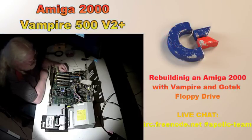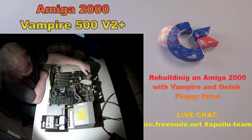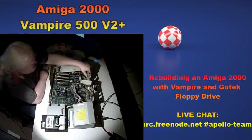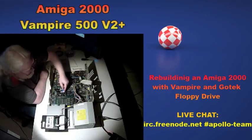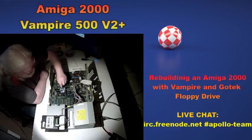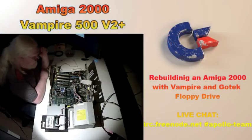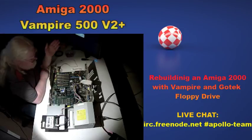I do believe it's doable. I did purchase a buffered IDE adapter for this purpose, and I don't know whether it's going to work. Originally, the problem I had is that it would boot the system, and it would seem like everything was reading fine and working properly. But after opening a file, reading a file, or writing to a file on the system, the file system would corrupt. And this was with the PFS3DS file system.